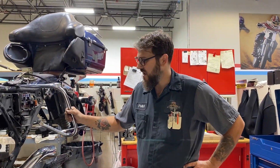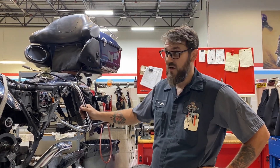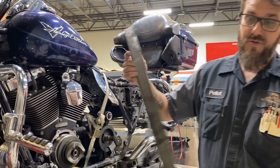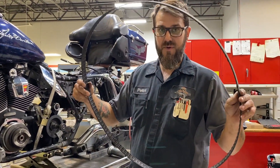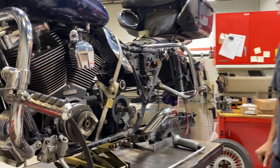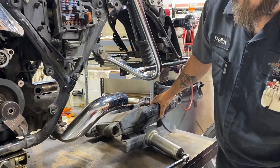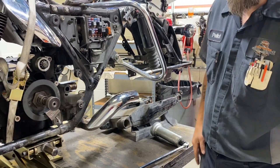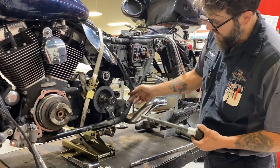We're back on the next phase of our belt drive replacement. We have the belt off and you can see the whole thing is completely stripped out. To show you what it takes — you've got to get the whole swing arm off this motorcycle for the belt to come off, which is why it takes such a long time, getting the pivot shaft out and the rear motor mounts off.